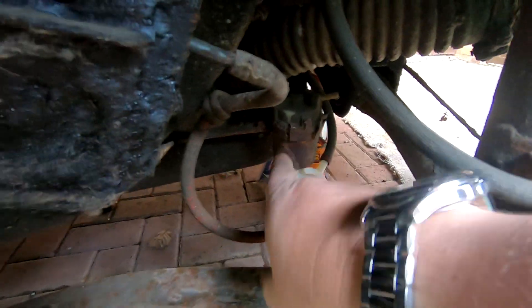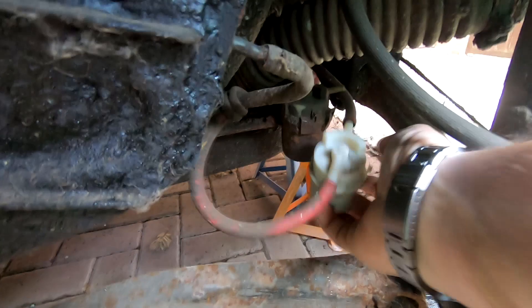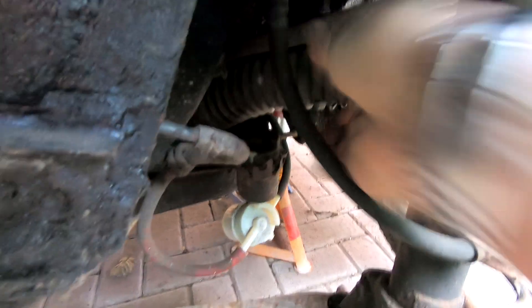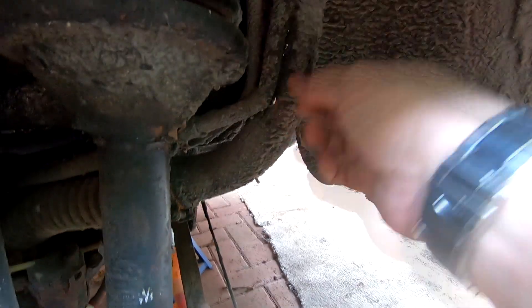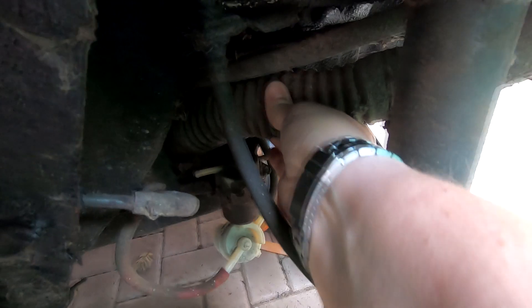As you can see, that's where the original fuel filter lives, and that was corroded in there — it sits on the side of the tank. I found the correct tank filter but I had to let it hang there until I came to take the tank off. You've got a flexible coupling that links on via Jubilee clip, and also another clip there. I might just undo that clip, because that pipe here — I don't really want to disturb it. So I'll undo that clip and that should just slide the flexible coupler off with the tank.